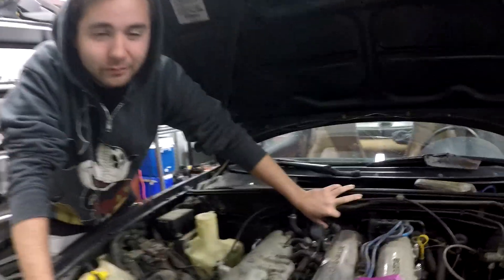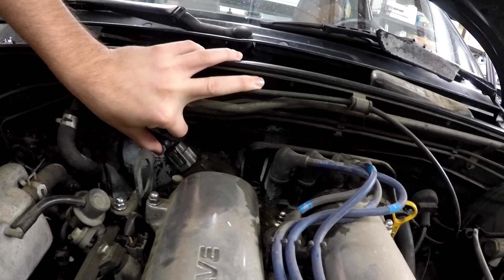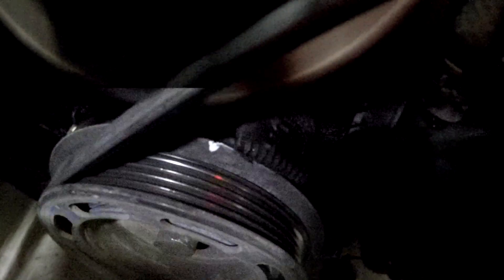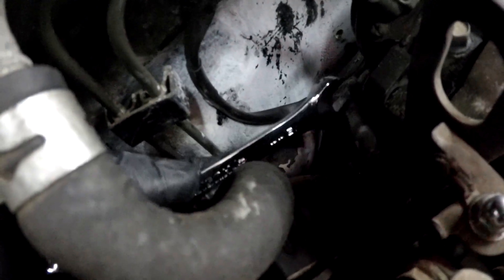You can see that little white mark flashing with it — the 10 is right about in the middle of that bracket thing you time it with, and it's pretty advanced at the moment so I'm going to dial it back. Matt got here, so he's going to adjust the timing. You can hear just a little touch makes the engine run differently. I'm going down there to show you exactly what happens when you move that. You see that line moving? Rotate it clockwise from your point of view. Right about there is 10 degrees — I'm going to advance it just a little bit and set it to 14. As soon as you get your timing set to where you want it, come straight back to the cam angle sensor and tighten that bolt so you don't change your timing by accidentally bumping it.